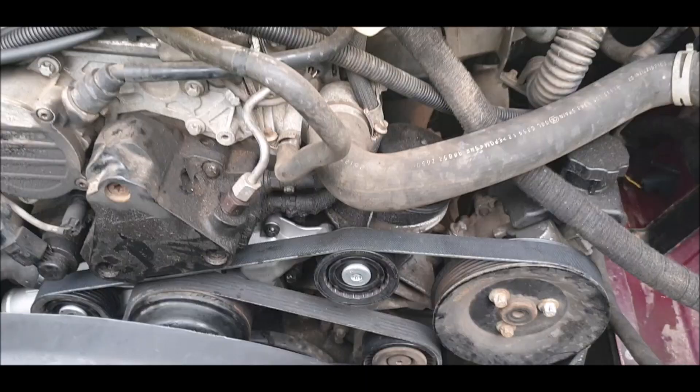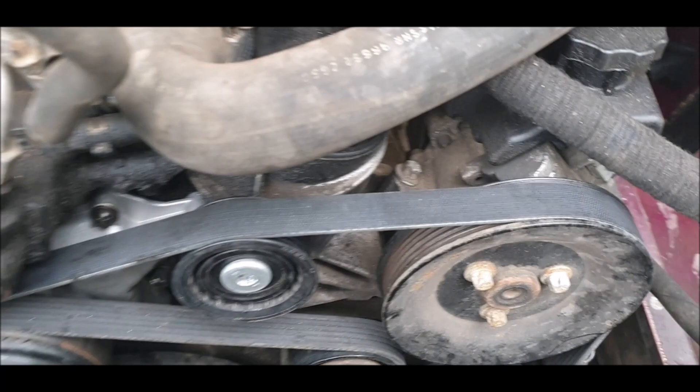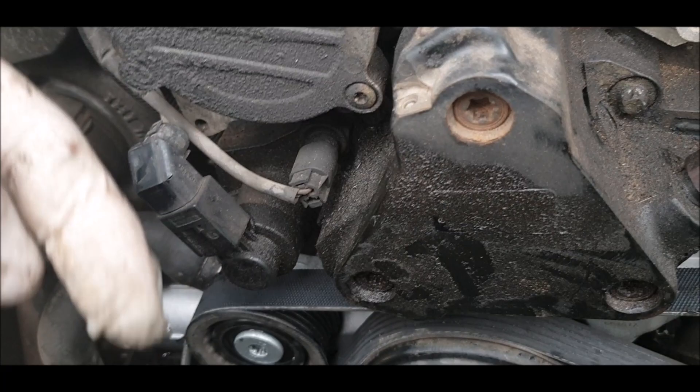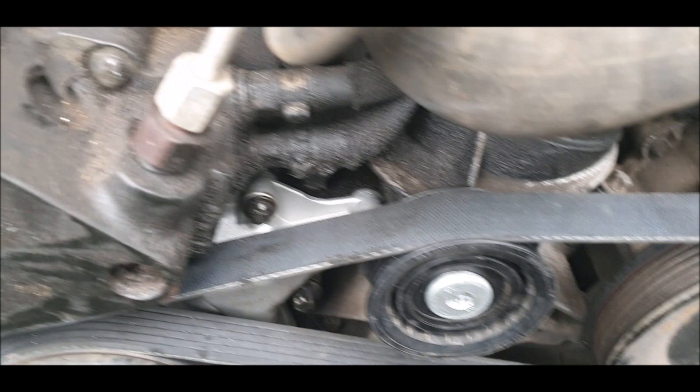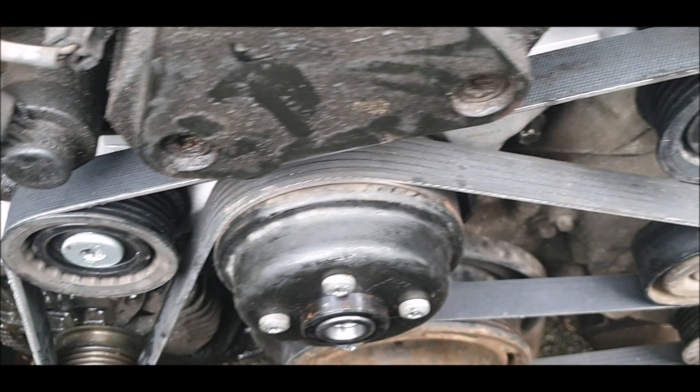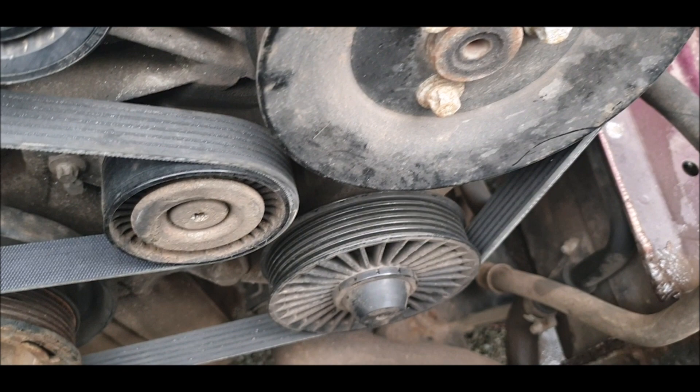So next will be — put it all back together. A bit of an update — I've had no one to give me a hand. Put the water pump back on — that is pretty straightforward. I used a tiny amount of gasket glue to glue the gasket to the actual new water pump — only a little bit, no glue on the other side. Tighten them up to 14 newton meters — really it's just hand tight. Put the belt back on — that's pretty straightforward. Over the top, follow it round. I bought a new belt — not worth taking a chance after you take all this apart.